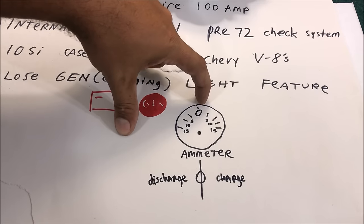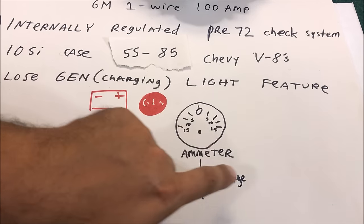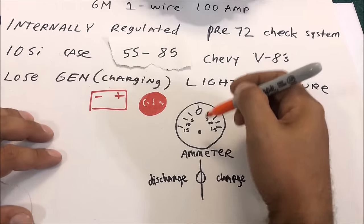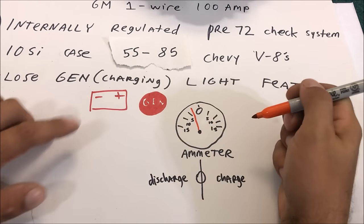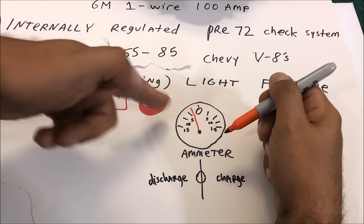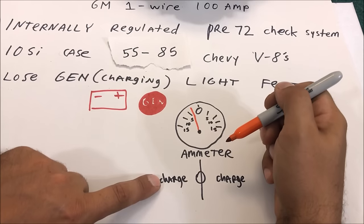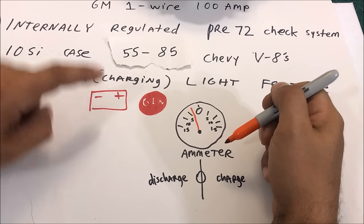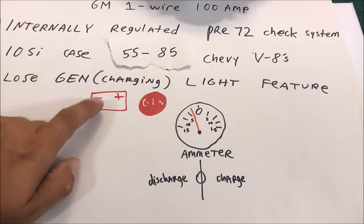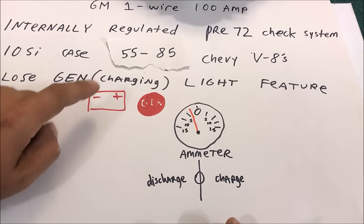If we added an amp and cooling fans and our charging light comes on, that means our system is not being charged - we've got too much draw on our small alternator. We're discharging, so our gauge will read below zero. That's why the gen or battery light comes on - we're no longer charging. That battery light means you're using up the juice in your battery, and it'll eventually drain it dead. This gen light has saved me two times.